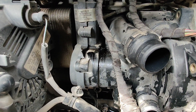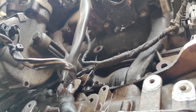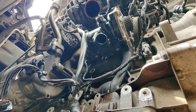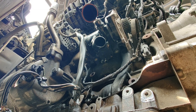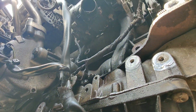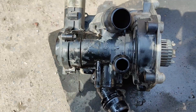The basic problem was it started leaking water into the electrical housing, which messed up the whole system. Looking from the bottom of the water pump assembly, you can see there are two holes. We just undo those five T30s and pull the water pump assembly out. It's a better approach as you don't have to pull the whole intake manifold out — there is a lot of disassembly involved with coolant pipes and charge pipes, but it's the better way. Don't forget to disconnect the electrical connector at the bottom of the water pump. The five screws are captive so they won't fall out.